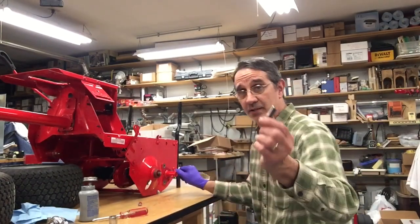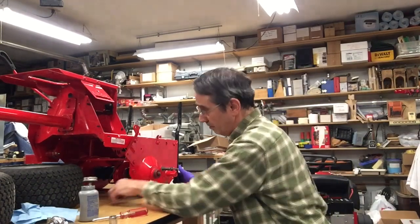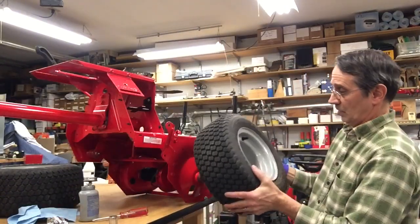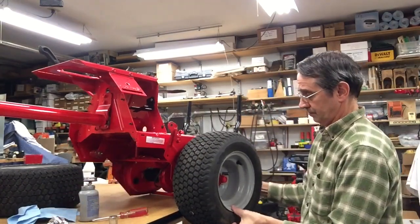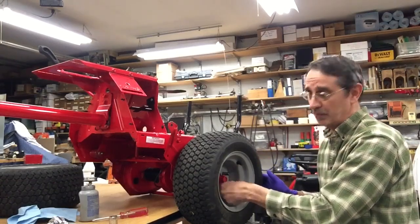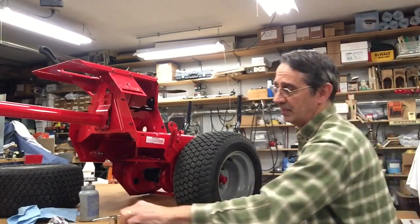Now in a previous video I talked about these studs that I use just to help get the tire on. Now we're just going to slide this thing over here, make it a little easy to put on the tire. Now with them studs in there, the bolt lines right up in the hole. That's got to be the best thing I ever come up with. Get one bolt in, take one of the studs out. You don't have to have them threaded in very far.